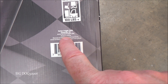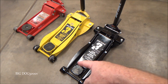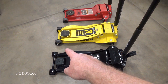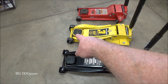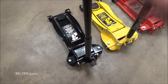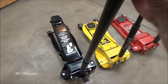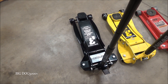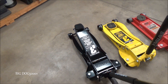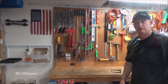There's all three next to each other. I went ahead and bled the jack according to the instructions so it's all ready to go. You can see it's a little bit lower, a little bit longer, and the pad is a little bit smaller than that one — I think that's to get into tighter areas. It's very similar to the other Daytona. It does have this little foot pedal here — you can raise it up just like that and lower it like normal. And it's a rapid pump, so just three or four pumps and it'll be all the way up, which is kind of nice.